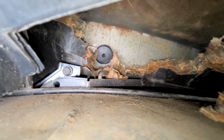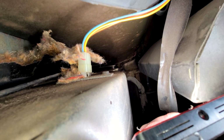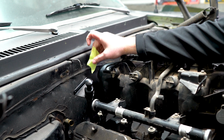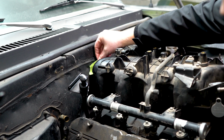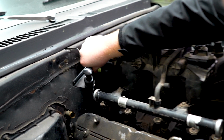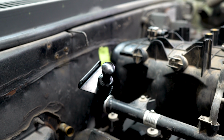I think that's right on the passenger side of the valve cover. So I'm going to take that guy out, and I think that's going to be our spot, because then from there, this is the back side of the glove box. We could definitely mount that ECU up top on the top side of the dash, and I think everything would work great. So we know we can have easy access to this plug inside, but I really want the harness to be hidden behind the intake manifold. So I'm going to mark this piece of tape to put as far as I want it to be. That way when I take off the intake manifold I know where, and I can go and confirm inside the car.